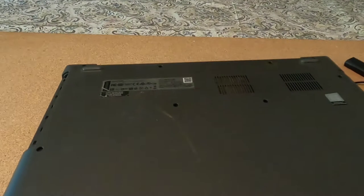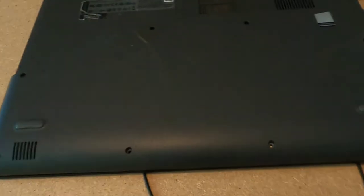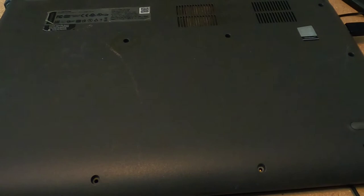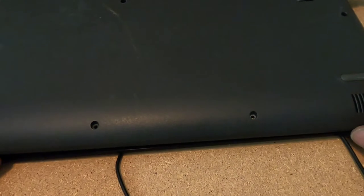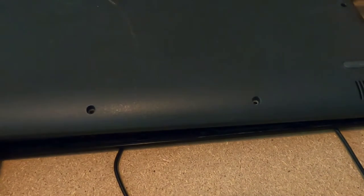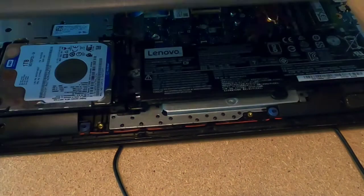So I close this up and flip it over. I'm just showing the steps I took. You have screws in the back that you have to take out — Phillips screwdriver, nothing difficult about that. Once they're out, you have to split open the case. I didn't want to use a screwdriver since it would mar it up, so I cut plastic from a one-gallon milk jug — thin enough to get in there and split it open all the way around. You'll hear popping as you go. When you pull this off, I found you open it from the front but push it to the back to get it off.